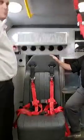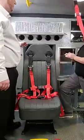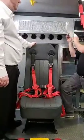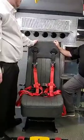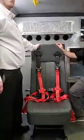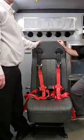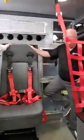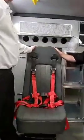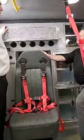Idle time kills trucks, even the diesels. You know, it doesn't like to idle. They tell you every hour of idle is 100 miles. We have a very aggressive preventive maintenance program in our shop. We're running a 3-week interval on our preventive maintenance, and as we get more of these trucks into the system, we'll probably be able to hold that maintenance interval a little bit longer and save some money on the PM cost because we're not running the engines as much. We're able to shut down the pump. As you can see, we put this down just to kind of show you how easy it is to maintenance this screen in here, right?